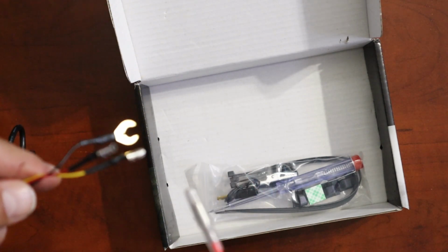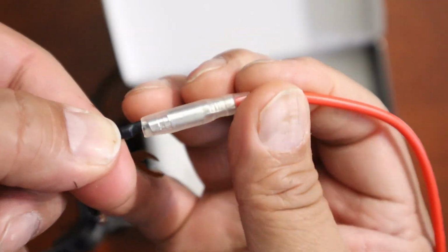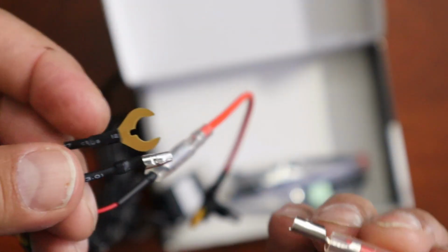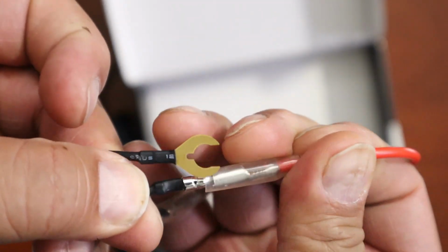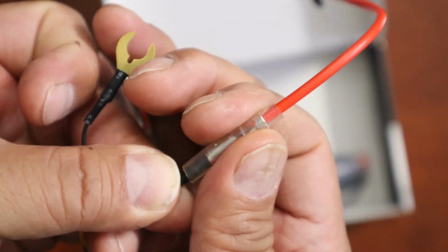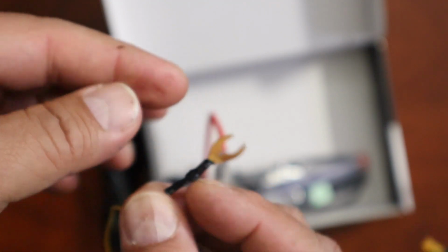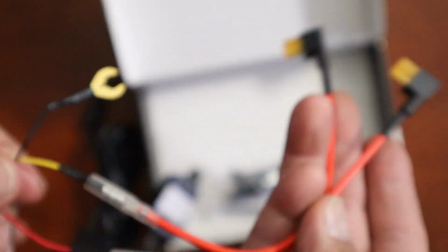And the way you use these, all you got to do is grab these and push it in there and it snaps in. That's all you do. You do it for both of them. Let's do the other one. All right, going to grab the one we need. Going to push it in there. And then you can push this protector covering right over both of them. And this one here, on your fuse box, usually there's a bolt there. You just loosen that and push this behind there and then tighten it up. This grounds your hardwire kit to give it power.